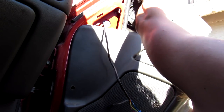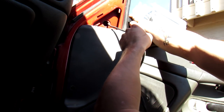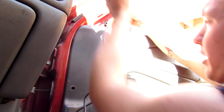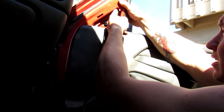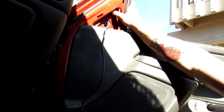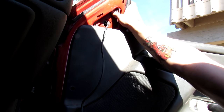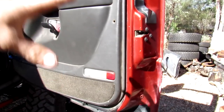Basically super simple — they go in the way they came out. Something sounds a little bit loose in there. We got the mirror set in. Take your top bolt and just set it down. Once that one's kind of snugged up against the body you can let go of the mirror — it holds itself. I'm gonna tighten these three bolts up and assemble all this stuff, which is just the reverse order: plug everything in, put the panel back on, put all the little stuff in and all the bolts in.